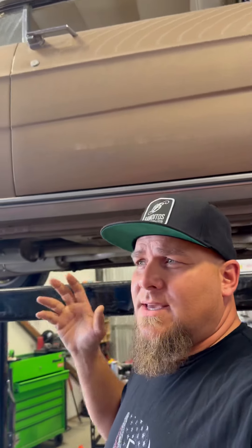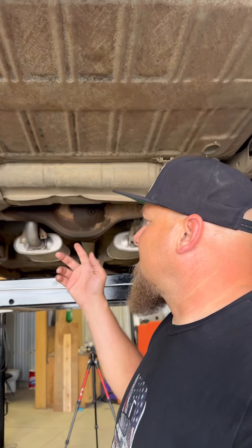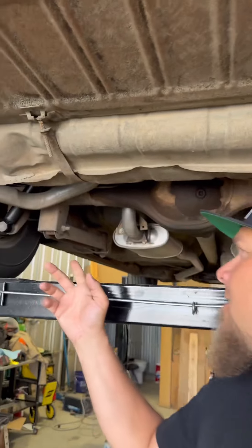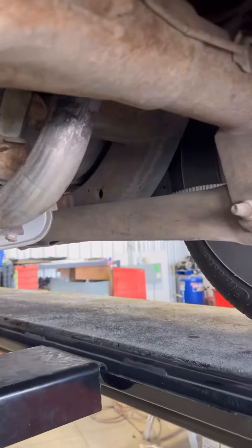However, it's getting to a point where it's time to do some upgrades. The biggest downfall of this car, other than no overdrive, is the factory 3-link. Stamped steel. It's a bit of a wiggle wagon. When we're doing 80 to 90 miles an hour down the freeway, it just likes to do this, which is not fun.